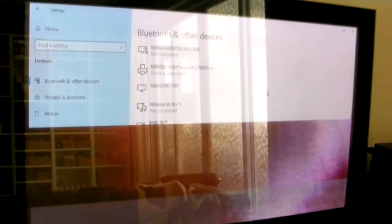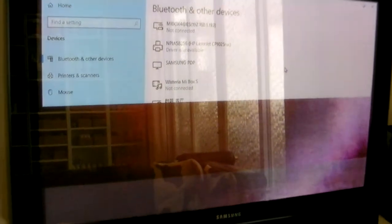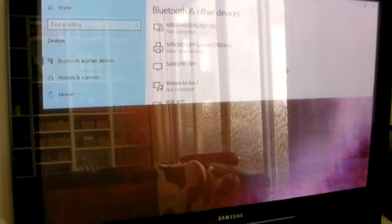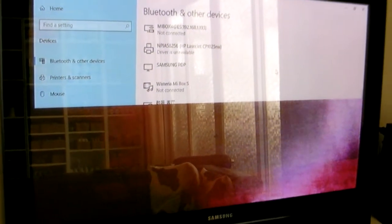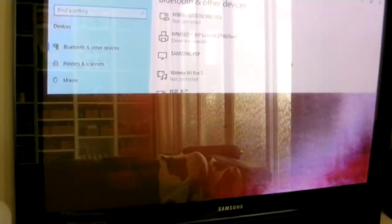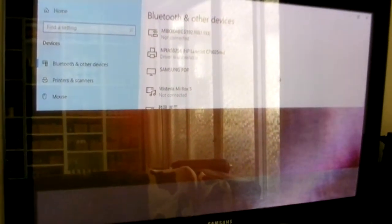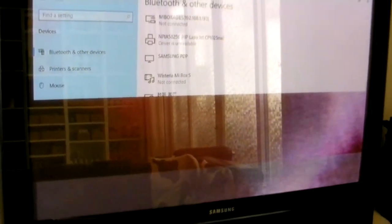It's either a failed component that's just flickering in and out of service, or, I think more likely, a loose connection. I think inside this plasma screen, one of the boards either has a dirty connector or a connector that's worked loose, because the plasma is quite hot. It gets hot and cools off, and gets hot and cools off, and one of the connectors has maybe come loose. This means I have to take the plasma apart, which is not something I'm particularly afraid of. I've already taken the 4K LCD apart, and I'd just be reseating all of the connectors and seeing if that solves the problem.